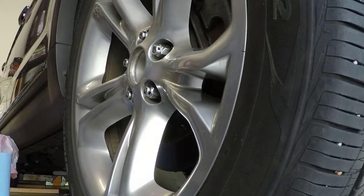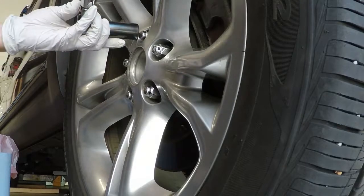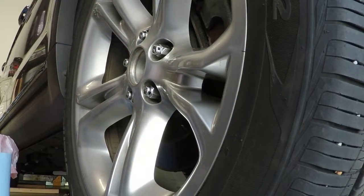So that is about it, actually. We got them tightened. I feel pretty good. I haven't gotten this to 100 pounds yet, so let me work on that. Still got it set at 258, just kind of skipping a step. Drop it down to 100 foot-pounds for the wheel lug nuts. There it is. It's going to be 90 plus 10, it looks like, for this one. 90 plus 10, there you go, 100.